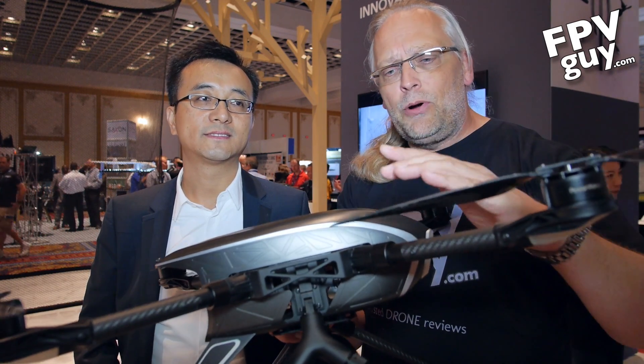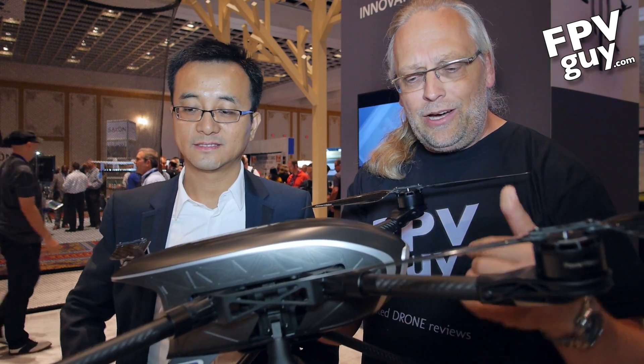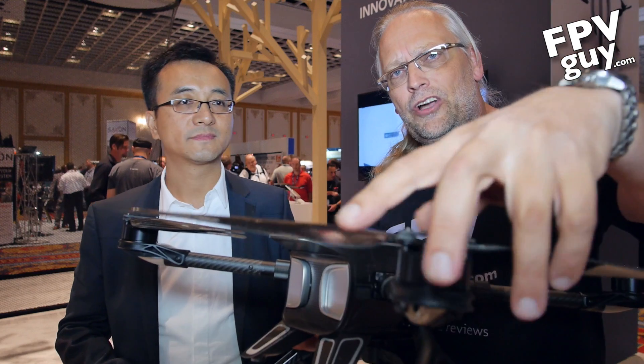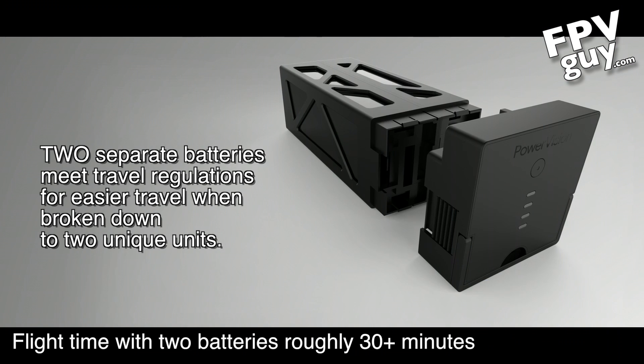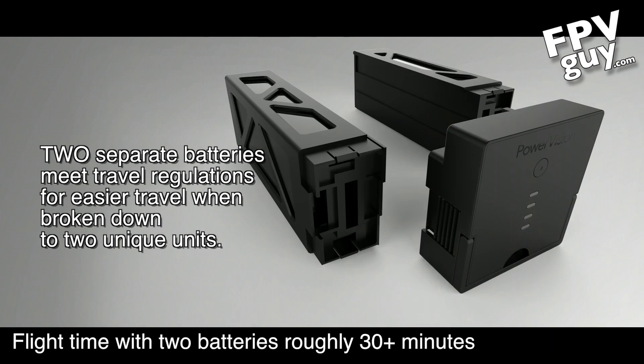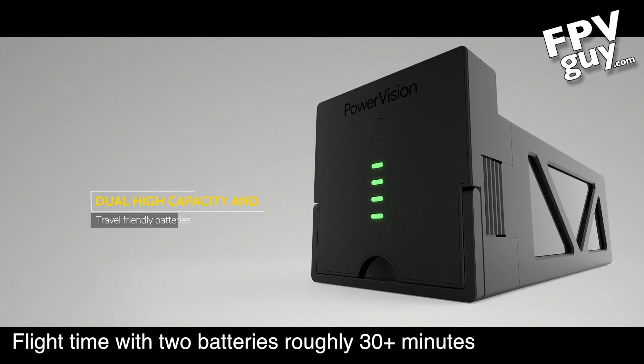If we go around, things that are important to notice here: all of this folds down, so the arms unscrew right up here and they fold down. Another really cool feature — we've got the folding props. Back here is the battery door. When I pop this open, you can see it's using two battery modules. You do need both batteries, however the advantage is if one of the batteries is going south on you a little bit quickly, you'll get a battery warning but you're not going to see your complete cell fail. So you have the redundancy advantage we used to have in the old days when we'd fly two or three batteries on a multi-rotor.